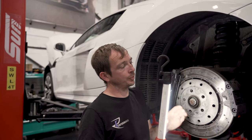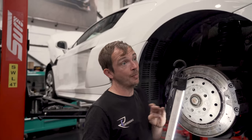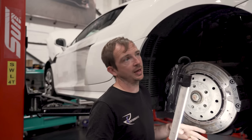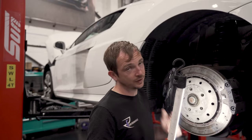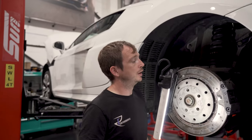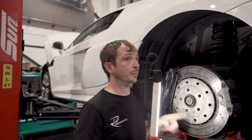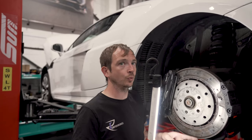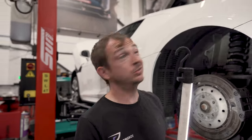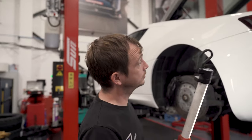And if you are buying a V8, just make sure the bottom ball joints or top ball joints are mint, because unless you send the arms off to VPS in Poland, you're buying V10 suspension because they don't make the V8s ball joints anymore. They're different sizes, so the hub's different, and because the hub's different, the wheel bearing's different. And other than that, just buy a good one, get it checked, good as gold.